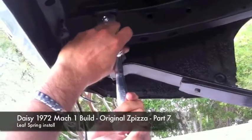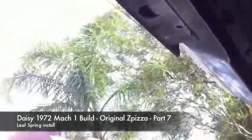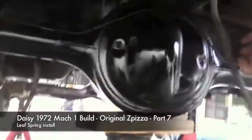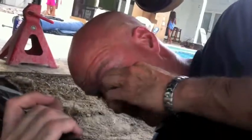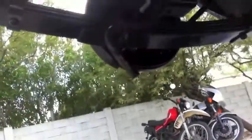I don't want it to be too tight on the rubber — okay, it's good. What I'm gonna do now is lower the axle. I got something in my eye — I know guys, I should be wearing goggles. Now I'm gonna bring it down and push it forward. I want this pin right there to line up with that hole, so we're gonna slide the axle forward, lay it into the spring, and then the bracket goes around that bolt right there.